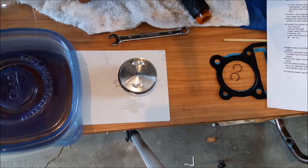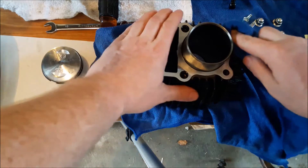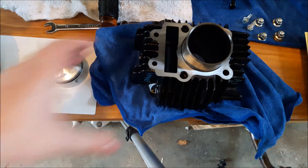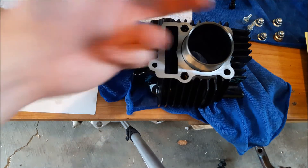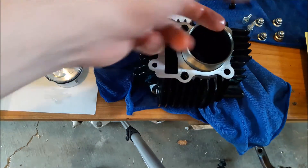What I'm going to do is slide the piston into the cylinder before I mount it, because it does make it easier. I've got my cylinder here. I went ahead and cleaned all the old gasket off the bottom — if you have any residue left, go ahead and clean it off. I would recommend wiping the cylinder out as well, just look down in there — debris free. Go ahead and take your oil on your finger and just kind of coat it. You don't want a dry start, whatever you do.